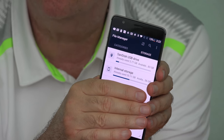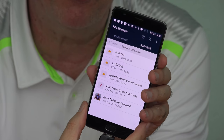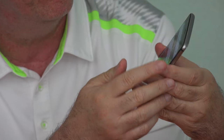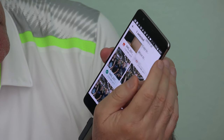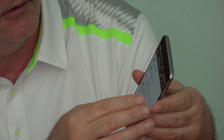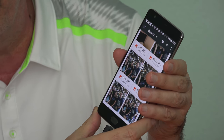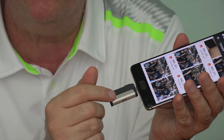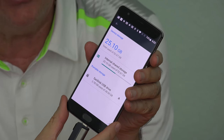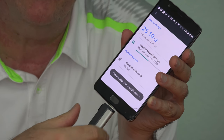It shows up in File Manager along with my internal storage and my Google Drive. Here are the files and folders on it. I'd like to see if I can transfer something from this phone onto it. I finally found a way where I can go into the photos, select it, choose to copy to, and I've created a new folder on the SanDisk drive called Test Photos. It's now copying the photo from the internal storage of the phone into the folder called Test Photos on this drive. And when I'm done with it, I can easily go into Settings, Storage, and I see the storage devices there including the SanDisk. This is the symbol for eject, and it's now safe to remove.